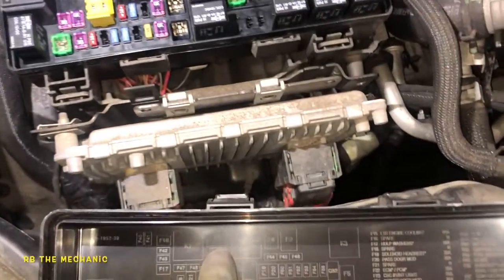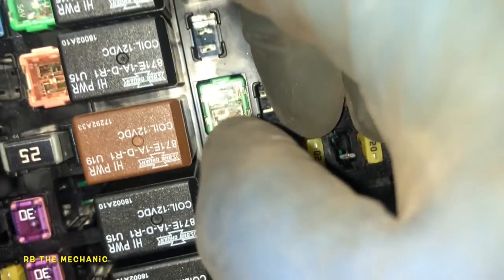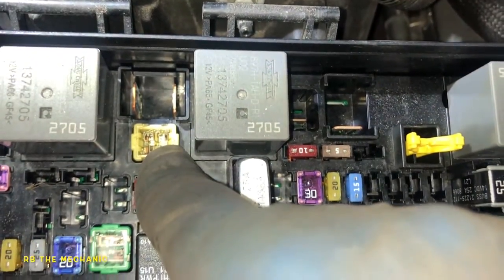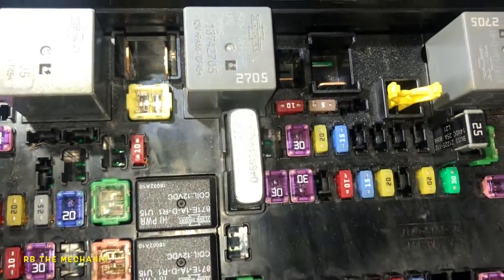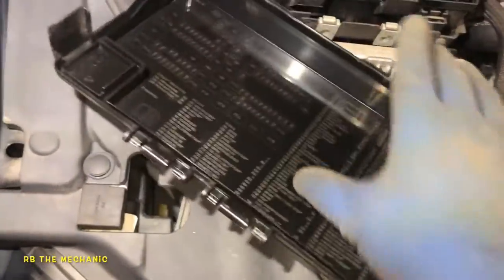Right in the middle you've got the fuse. The fuse we're looking at is F3 — right here, radiator fan. This yellow fuse here — I can't tell how many amps it is, it doesn't say on it — this is your fuse for the radiator fans. You want to check that. You do have a fuse puller here, but this puller is only for miniature fuses, so that's about it on this side.